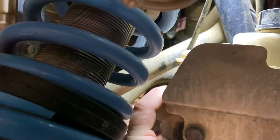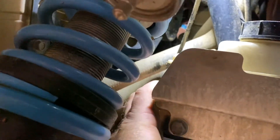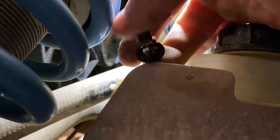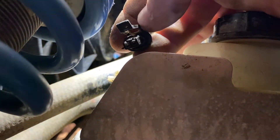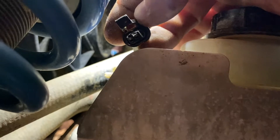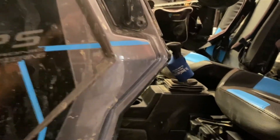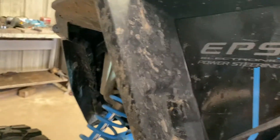You can feel it with your fingertips. There's a plug right here — if you jump those two out, it'll let you start the Razor. Now it's going to throw a check engine light, it's going to throw a power steering light, speedometer's not going to work, fuel gauge is not going to work — a lot of stuff won't work. But if you pull the jumper back out, everything will go back to working.